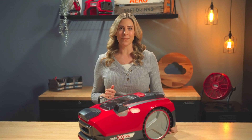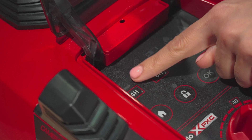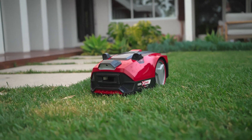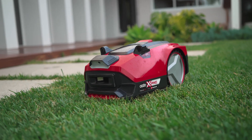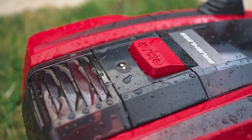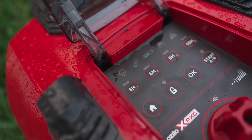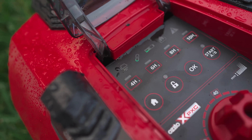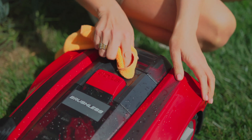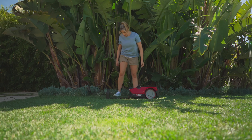Let's get into some troubleshooting now. We're going to work our way along the control panel from left to right. First up is the rain indicator. On the back of the unit, you'll find a small well with two metallic pins. If it rains, this well will fill up with water and create a connection between the two pins. This sends a signal to the robot mower, informing it that it's raining and it's time to head home. You'll also notice the rain icon will be illuminated. If the rain has cleared and it's time to get back out, simply clear the water and send the mower off. Alternatively, you can let the robot mower stay in its dock and resume the next day.